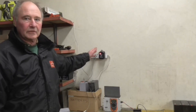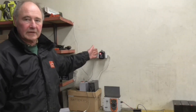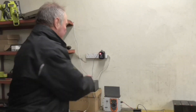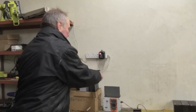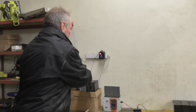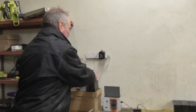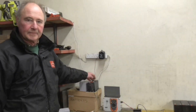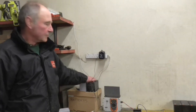Leaving it on for a full day is fine. When I connect this same charger — black to black, red to red — to the discharged battery, you can see the charge light goes out, indicating this battery is discharged and will need a full 12-hour charge to come back up to spec.